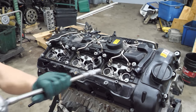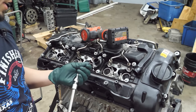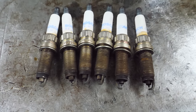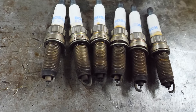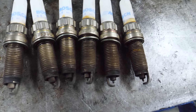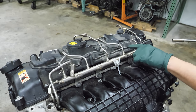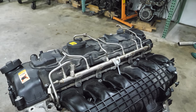The next thing we're going to do is pull the plugs. That wasn't tight — I don't think any of these are tight. This is kind of surprising: all of the plugs look like they have some miles on them; they're not brand new looking even though the engine is pretty clean. But I don't see any bent straps, I don't see any damaged electrodes. They all look pretty consistent, which is a good sign, and they are the right plug. The next thing I'd like to do is remove the fuel rail, which has integral fuel lines that have been manhandled by some barbarian for some unknown reason.